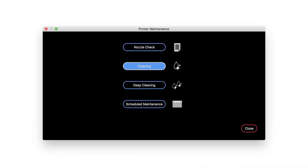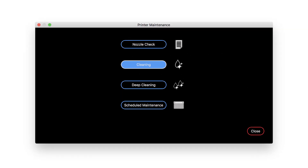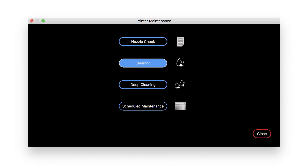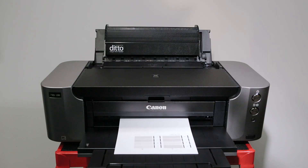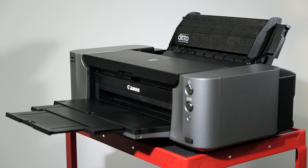If you do have gaps, you may have a slight clog, or the printhead needs help charging the ink. Run a cleaning routine using the AccuRip Ruby cleaning feature, then print another nozzle check to ensure the clog is removed. You've now completed the cartridge refill process. Your D-Max all-black ink refillable system is a true continuous fill system that will run indefinitely, saving you huge ink costs while printing thousands of films.